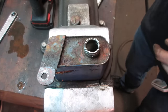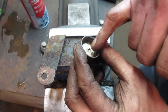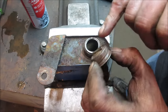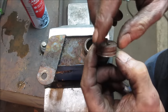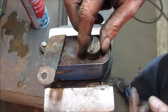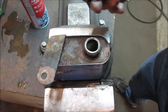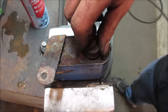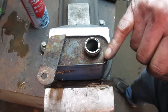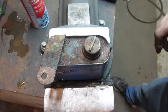It now has a built-in air vent. Look at the cap that was on there. He actually made a vent, punched through the center of it. He brazed a piece of small tubing on it, and I'm sure that's got a hole down in the center too, and it comes out there. The amount of time that somebody spent on this is amazing. But now it's got pinholes going in this way, so it's going to vent in that location. I don't think water, there's none that are low, so even if this gets water on it, I don't think it's going to come up over it and go in there. All right, let's try to get that back on there.